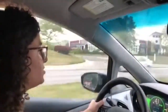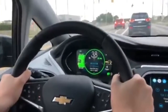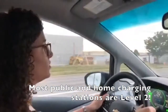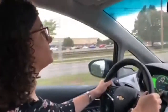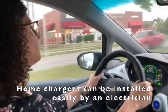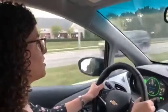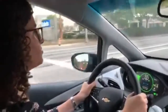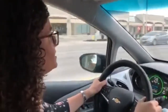This vehicle has 260 miles of range on a full charge. The most common type of charging you'd be doing for this car is Level 2 — a 240-volt outlet, like what you would use for an electric dryer or electric range. If you were to install Level 2 in your garage and charge overnight, it would take about 10 hours to fully charge if you really ran the mileage down to zero. That's pretty uncommon — most folks are not driving their vehicles all the way down.